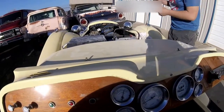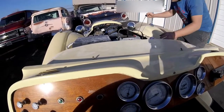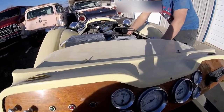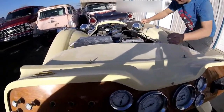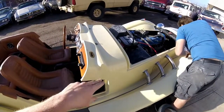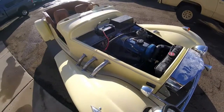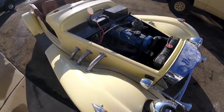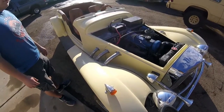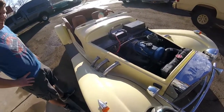It did have fluid, and apparently the trick is you go from reverse to drive three times and then it empties the pan, but the pan will be full until you do that. Four quarts later it might actually be full for real now. Ignore what happened earlier - we were just breaking in the clutches. Current theory is that maybe all the little paddles on the pump were stuck, because this thing read in range and we couldn't get it to move. It wasn't until we got it to move out here that it finally sucked the fluid down and actually tried to move.